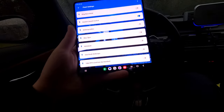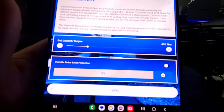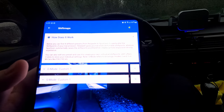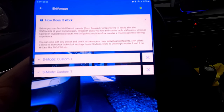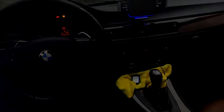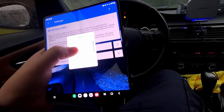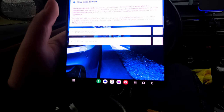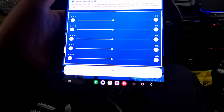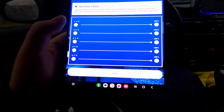Custom torque control I've left at 451 Newton meters. Override brake boost protection I'm not messing with. These are the shift maps — you got drive, sport, and full manual mode with the paddles. In D mode I'm going to do 'Relax Plus' since it's like comfort mode. Sport mode I'm going to set to 'Sportive Plus' — the most aggressive option. Manual mode is full attack. For throttle blips I'll leave it at stock 50%, and if I need to turn it up I will — higher just makes it more aggressive. Shift speeds in manual mode I'm maxing out because I want it as fast and crisp as possible.